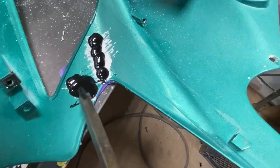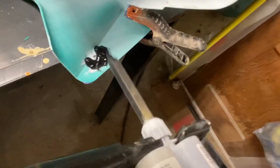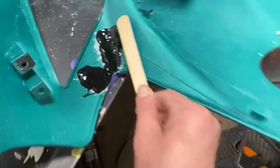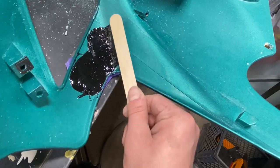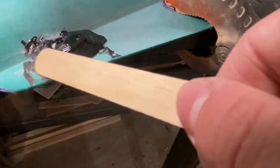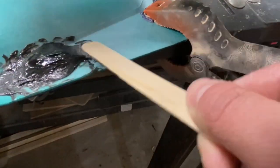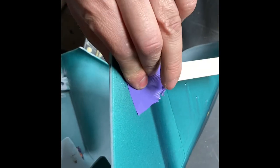So once I got all these tabs glued together and prepped and ready for primer, I had to really, really wash these panels good, because I knew that with all this road rash and use, these panels very well could have grease or other contaminants that would conflict with the primer, base coat, clear coat, all that kind of stuff. So I really took the time, and I don't think I showed any video or footage, but I really washed them good. I actually used a scuff pad and this product called Ting, T-I-N-G, which is a nice washing soap for getting panels ready for paint or just really clean.